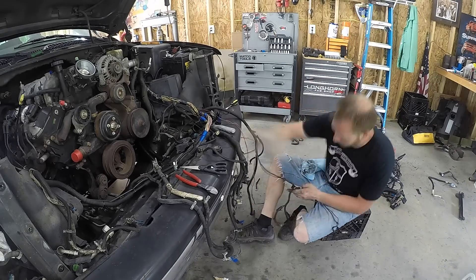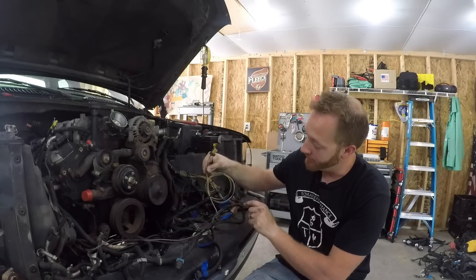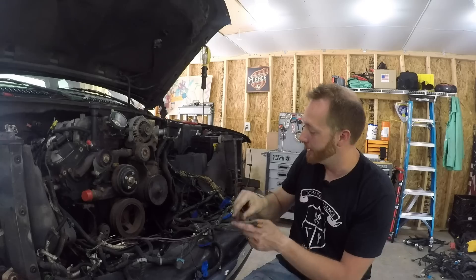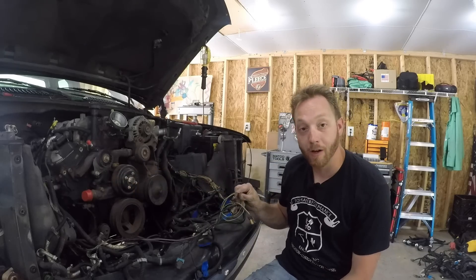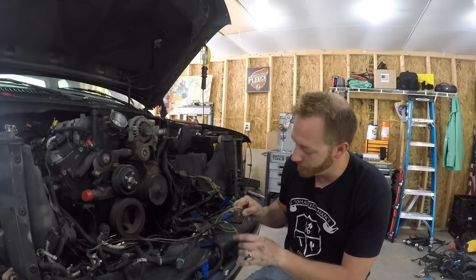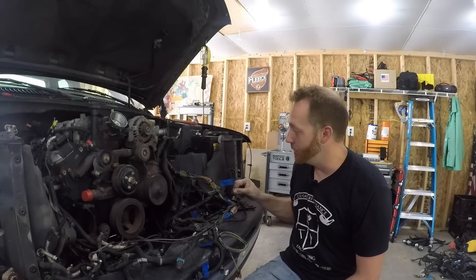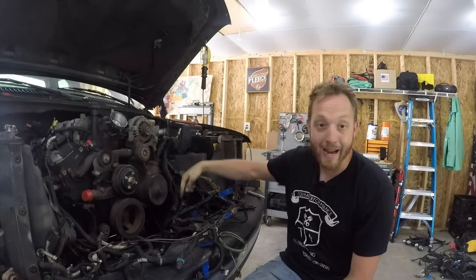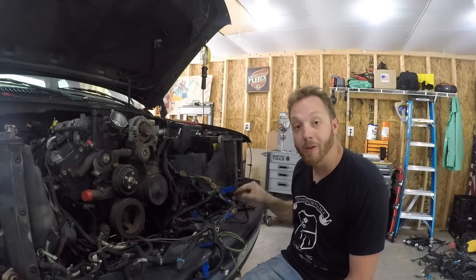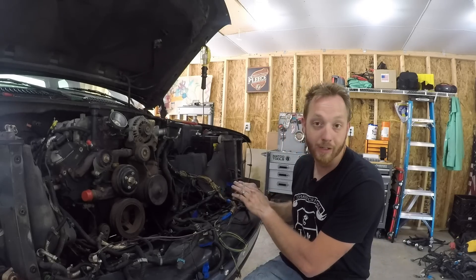This might look like kind of a mess at the moment, but most of the moving of the wires is actually already done. I believe there are four different things I had to change. Number one: the crankshaft sensor — I've got this coiled up here because there's a lot of extra wire, since originally the crank sensor went down below the front of the motor near the starter. Now it's going to run up into the branch that goes with the transmission — I've got a little extra that I'll trim off when I repin the sensor. The camshaft sensor was the next one to move — originally it went where the crankshaft sensor now goes, but now I've had to route it toward the front of the motor. It's not long enough, so I'm going to have to cut apart the old harness, take about another foot out of the camshaft sensor harness, and solder the two together.